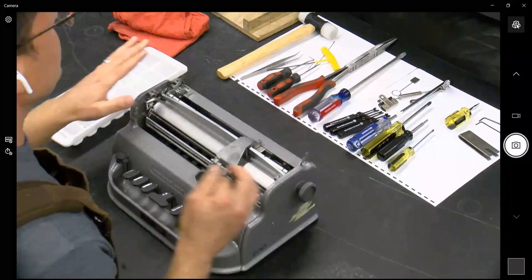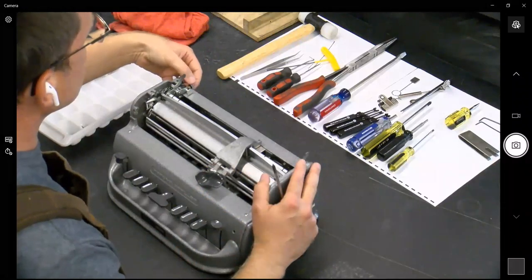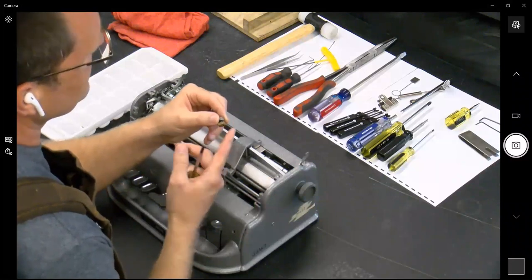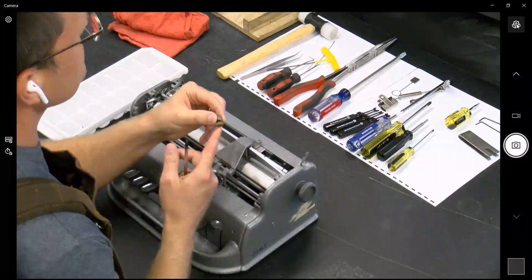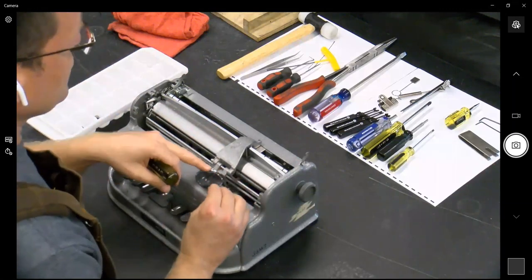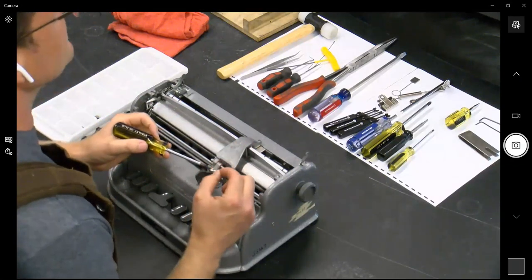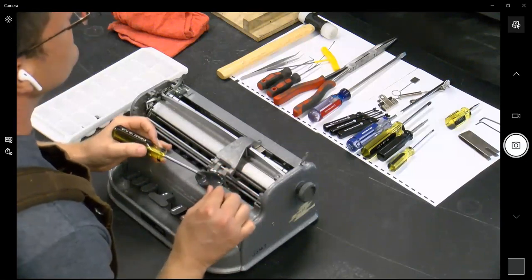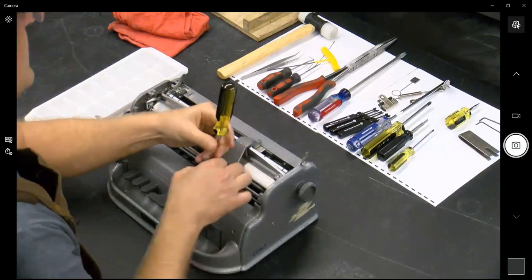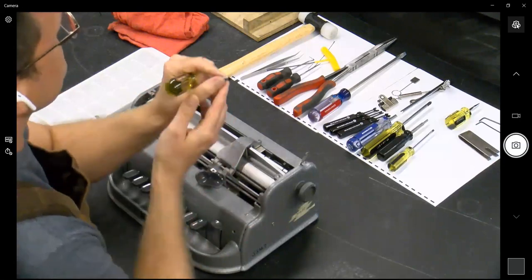While looking at the top plate, remove the paper guide — it just kind of rests on the back and you'll see a washer on there. There's a curved or beveled side to that washer, which needs to be facing the inside of the brailler — we'll talk about that more when we put things back together. There's also a little tiny split washer underneath the screw that holds the lever for the carriage. When you take that out, be really mindful of the washer — it can fall down the brailler or off the table.